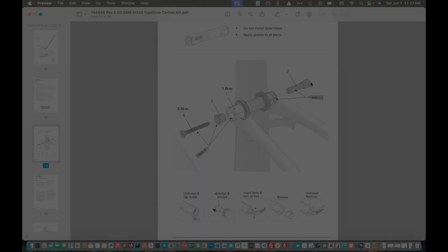However, when I was looking at the bike, there's also a Torx screw on this end too. So I'm not sure if I need to remove that or not. But anyway, I'm going to unscrew this bolt. This one may come out. If it does not, it looks like it's a 5 millimeter that's only torqued to 1 Newton meter. So that's not very tight. Then there's a 6 millimeter bolt or nut, or hex, somewhere in there. And then as I unscrew that, there's some threads here. So the axle, I think, is going to get pulled out from the non-drive side.